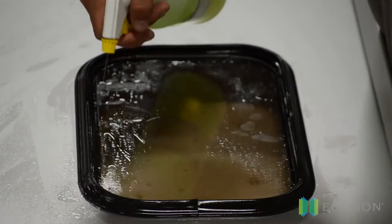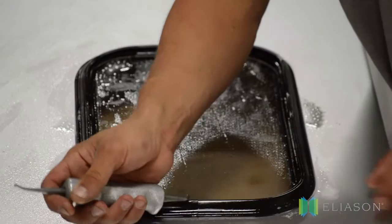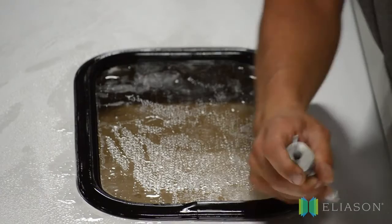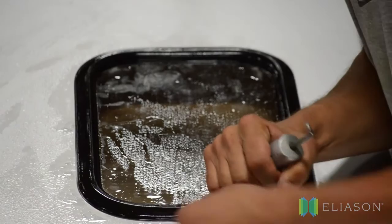Number five, respray the gasket, insert the hooked end of the gasket tool into the bottom seam of the gasket and slowly work your way around the edge to close the gasket. Be especially careful around the corners and add more lubricant if needed. If there is too much resistance, double check to make sure your window is properly centered and seated in the gasket.